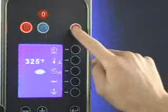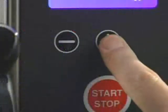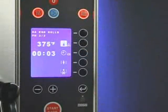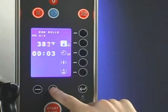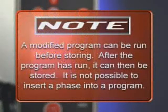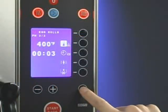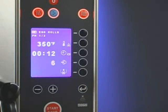To modify a cooking program, press the program button to select the program mode. The button will illuminate to indicate it has been selected. Use the plus-minus buttons to select the program to be modified. Modify the desired cooking phases. The program number will blink to indicate that it has not been stored. A modified program can be run before storing. After the program has run, it can then be stored. Note: it is not possible to insert a phase into a program. Press and hold the enter button. The buzzer will sound and the program number will stop blinking to indicate that the program has been stored.